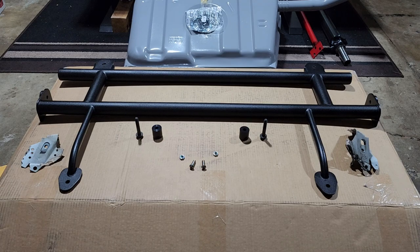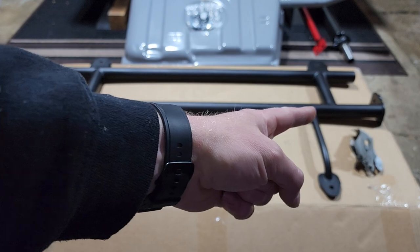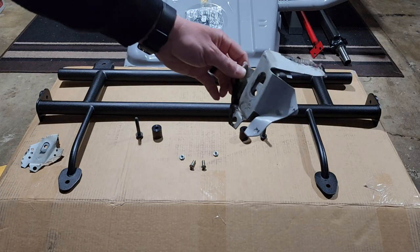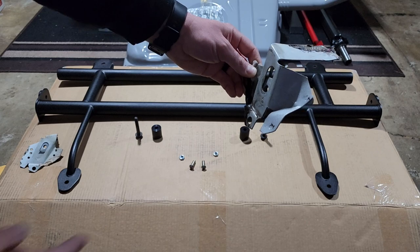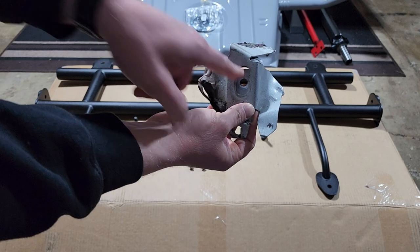You basically just remove those striker pins and you bolt this in on both sides. Well, luckily enough my Camaro had the single back seat, so even this option isn't a direct bolt-in. But I called Hawks and they were kind enough to actually offer the mounting brackets that hold the striker pins in the split backs. I need one for the driver side, so they sent both, and we'll just be taking this one to the shop and having it welded in — this just kind of goes on the wheel well and they'll just tack it in place.